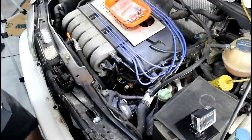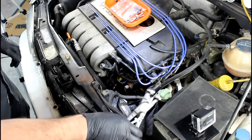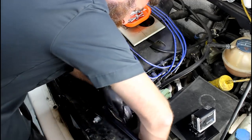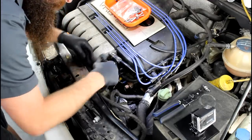We're going to go ahead and drain the coolant. I'm going to take the lower radiator hose off and let it drain out of the radiator — this is also a great opportunity to do a really thorough coolant flush. I've got my hose clamp pliers and I'm going to take the clamp off the lower hose on the driver's side. I'm also going to get this wiring harness out of the way — it's a twist lock connector, so you simply twist it and work it apart.